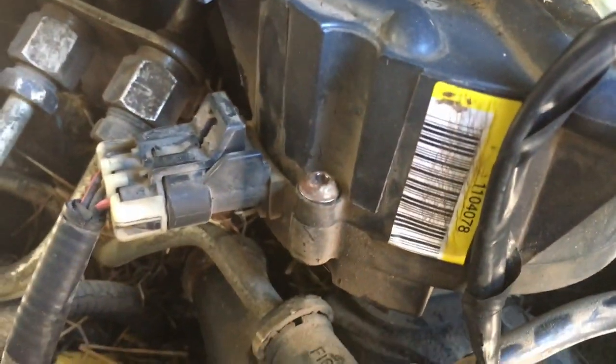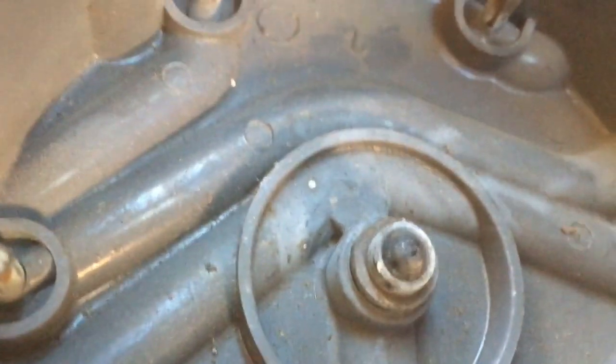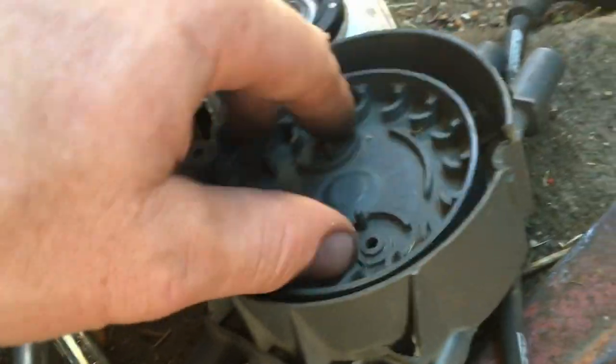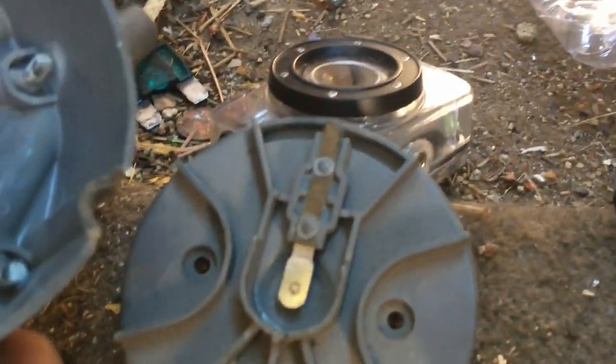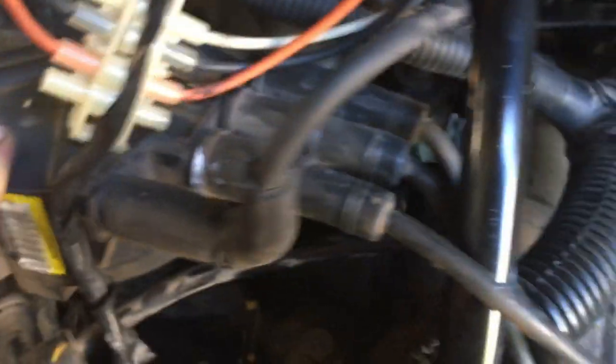The first thing I actually did was pull off the cap and rotor — that's the very first thing I checked. I wanted to make sure the points inside weren't rusty. This is my spare one, and you can see at one point it was corroded — I cleaned it up. You can tell when they're bad: there's all kinds of corrosion and funky stuff all over them, and the contact points are corroded. As the distributor turns, this spins around inside, and if your contact points are rusty you're not going to have a good electrical connection. That wasn't the problem, so I ruled it out.